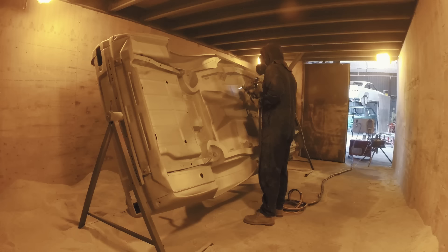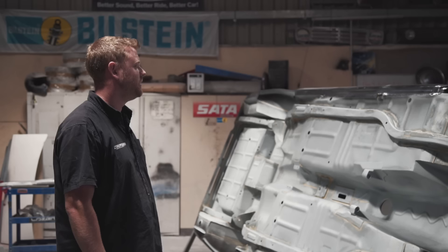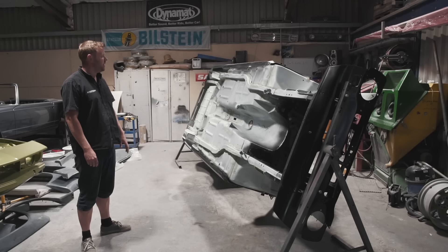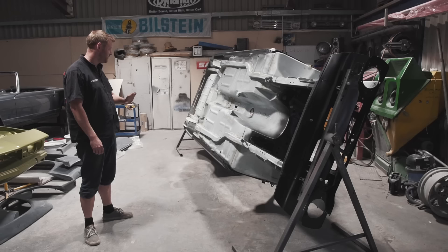It's a process often used on offshore wind turbines, oil rigs, and bridges. Because of the nature of zinc it's a sacrificial protection — even if the zinc gets scratched all the way through to the steel, the steel still doesn't rust because the zinc still protects it even without direct contact. We'll eventually go over it with a urethane coating tinted body colour, which will be the final finish and is also incredibly stone chip resistant. The zinc spray was done immediately after a fresh blast, which we do all over the shell to bring it back to perfect bare steel.